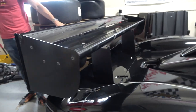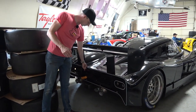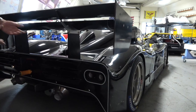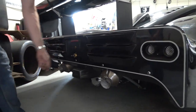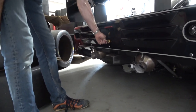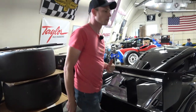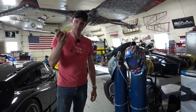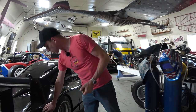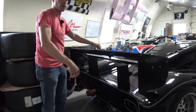In the back there's a rain light, brake lights, and believe it or not — turn signals. Here's your rain light in the center, just as you can see on formula cars, and then LED guys here for brakes. This thing actually has turn signals — maybe it's just to indicate pit in. And this guy here at the end is for very high pressure air or nitrogen — this is for your air jacks. A nitrogen bottle looks no different than a welding bottle, but you might crank that thing to 300 or 400 PSI depending on how heavy your car is. It's got four jacks underneath it, and to jack the car you just come over here and attach the hose — up it goes.